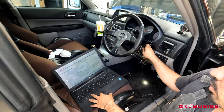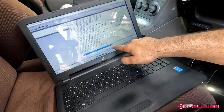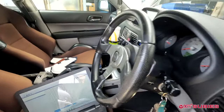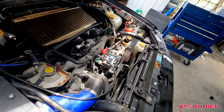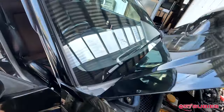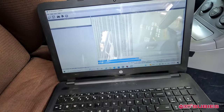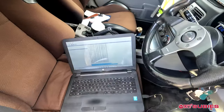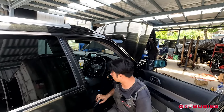I click ignition on and press OK — and you can see it's entering flash mode. If you go to the front of the car while it's flashing, even though the green connectors are plugged in, there are no relays being activated; your fans are not going on and off. That means you've successfully entered flash mode and are pulling the ROM. If your relays and fans start clicking, you either clicked the wrong definition or didn't press OK fast enough after turning the ignition on.